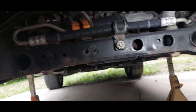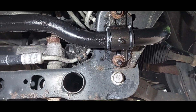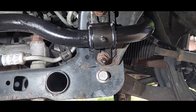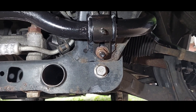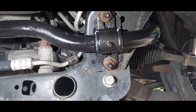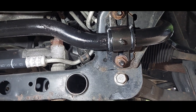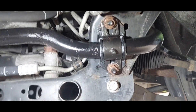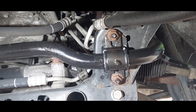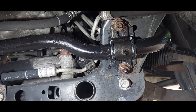That's where we're at - 33-millimeter Energy Suspension polyurethane bushings. In SAE I think it comes out to be inch and five-sixteenths, or at least that's reasonably close. That got everything in place. I did use those back pieces just because that is a thick standoff from the subframe and I felt it was important to have that standoff from the subframe. It may not be, but I personally felt it was, and it didn't make me go out of my way. Let me finish buttoning this up and we'll come back to it in a minute.